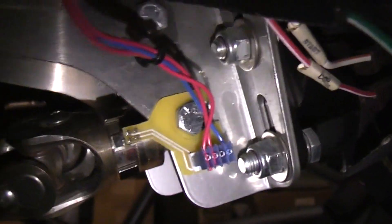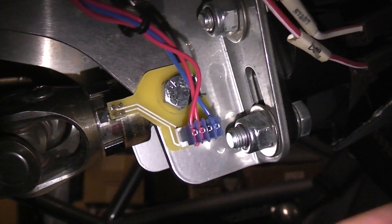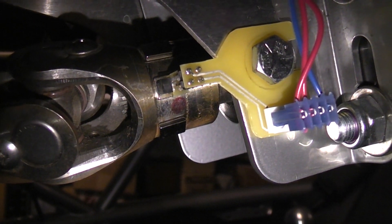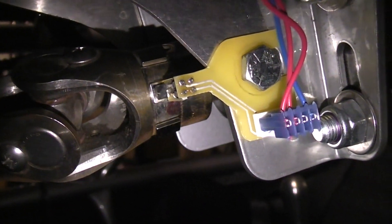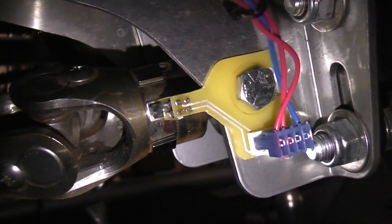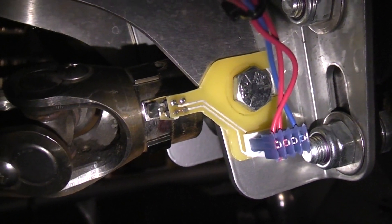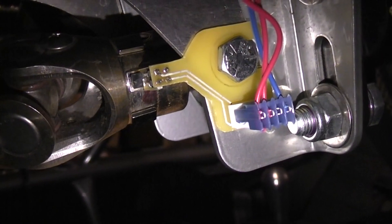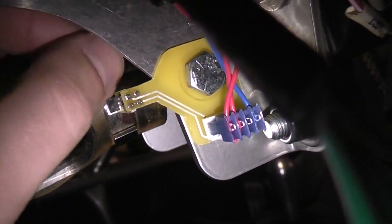Power comes in here, and there's a plastic cover that goes over it. We've got mounting holes — it's fire-safe plastic, an eighth inch thick, so it should be very sturdy. The sensor is specific to the Atom 2. You just loosen the nut, slide the sensor on, and tie it back in place. You can see I've got magnets attached on the steering shaft — however far apart you set them is how far you turn the wheel to trigger cancellation. I'll likely recommend wrapping one turn of black electrical tape around them to hold them in place. They're neodymium magnets so they're quite aggressive — I can't even pull one off without a tool.